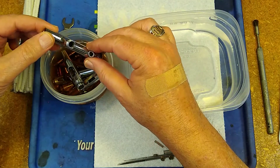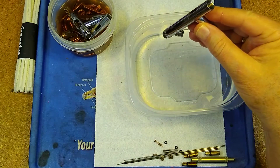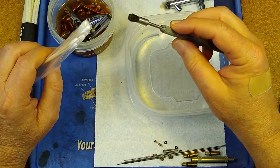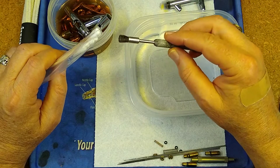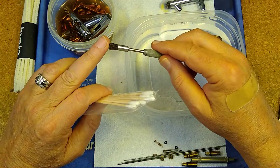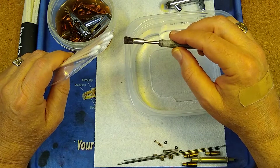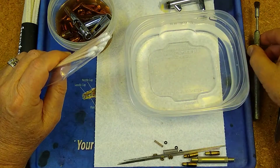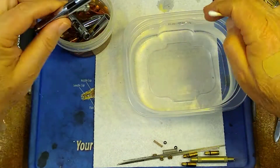Alright, let's start with the body here. They all look a whole lot better. We'll be using this square tip stiff bristle brush from a spray gun solutions cleaning kit. You can also find something like this called a stipple brush or a stencil brush at discounted art supply stores. Don't buy a good one because you're going to abuse it.